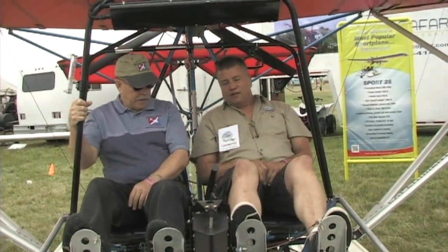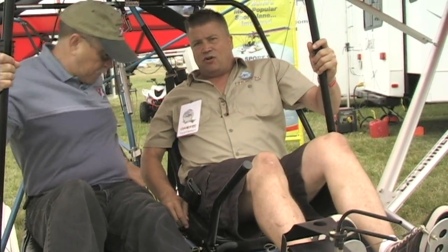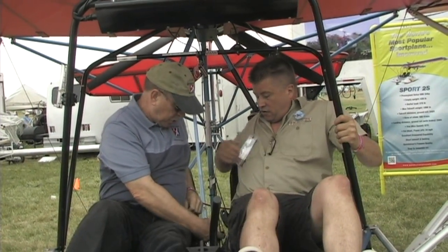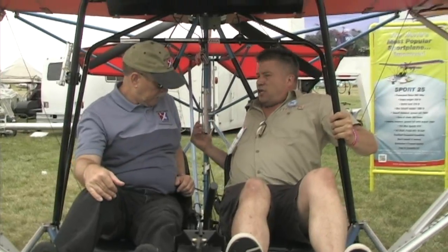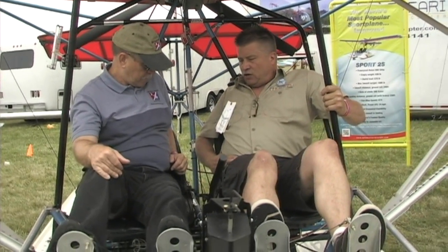We're going to take off on land and then go land on water. How does that work? Well, it's pretty simple. We've got the controls all within reach — retractable landing gear right here, and locks right here for locking the gear down or up. You push the control all the way up, it retracts the gear, and then you use these two handles down here to lock them in place so the wheels stay up. They'll stay up on the control by themselves — this is just a safety lock. But it's more important for when the wheels are down, so they get locked and don't accidentally retract while you're trying to taxi on land.